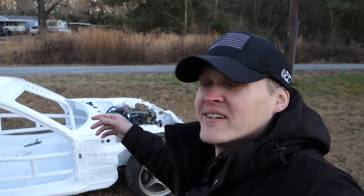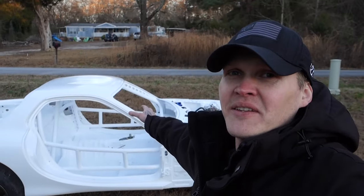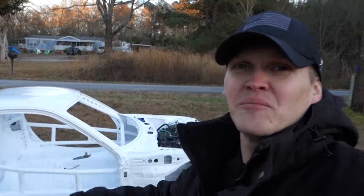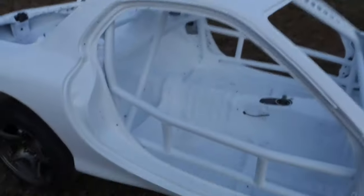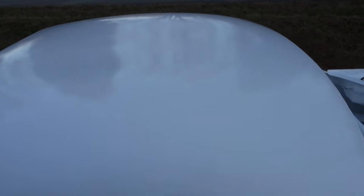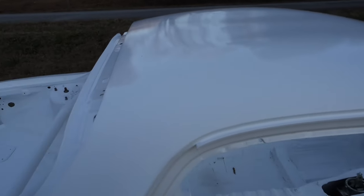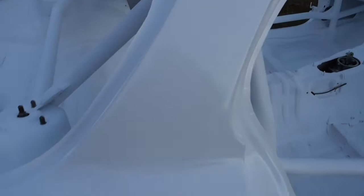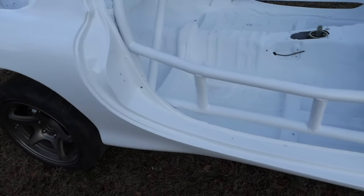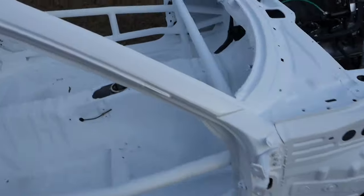Yeah, like I was saying, the paint turned out all right. Not definitely as, you know, the nice paint job I was hoping for, but not too bad. I think the main problem is just orange peel, but you're probably not going to be able to pick it up. Got some dirt on it, but it turned out okay. Wish it would focus on it, but I think it is actually fixable, just wet sand to buff it up.